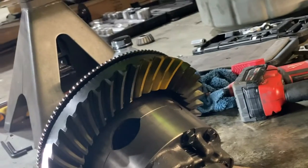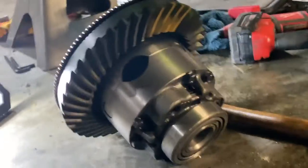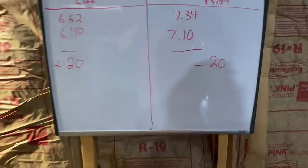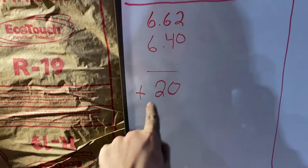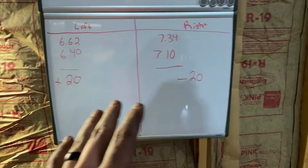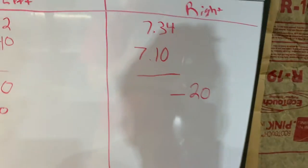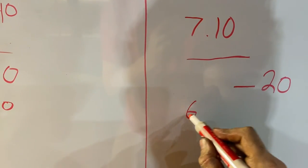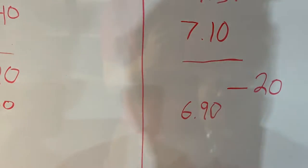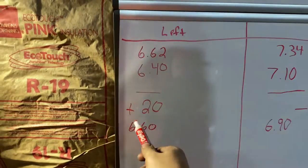Our pattern was too much on the heel. In order to get the pattern moved away from the heel, from my knowledge the carrier needs to be moved this way. So we went to 20 thousandths — we were at 710 and I took out a 20 thousandths shim, and we were at 640 and I added a 20 thousandths shim from the other side. So now we are at 660 on one side and 690 on the other, because I subtracted 20 thousandths here and added 20 thousandths there.